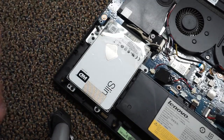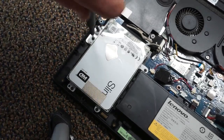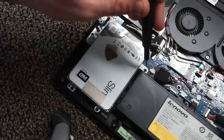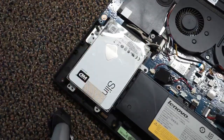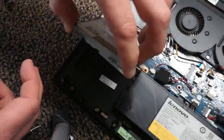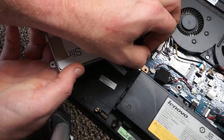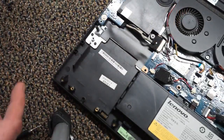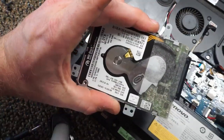There's a metal frame around the hard drive with four tabs on the outside. Take all four of those black screws out. Once you have all four screws out, lift up the hard drive so you have access to the wire that connects it to the motherboard. Grab that wire, give it a little tug, wiggle it slightly back and forth if needed, and it should pop right out.